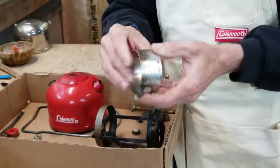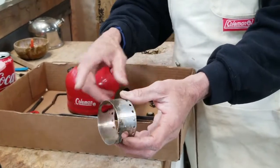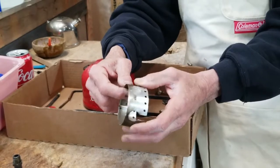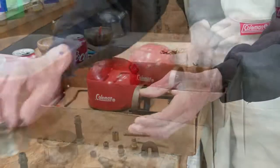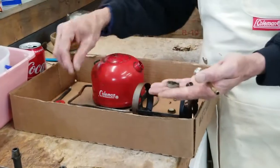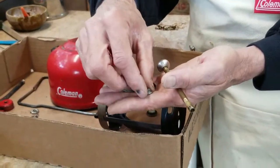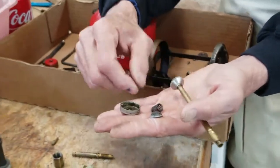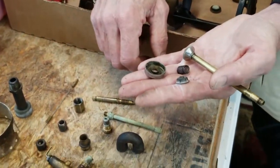For aluminum, I'm going to soak it in vinegar for a little while and then just take a rag and wipe all this stuff off — these usually come real clean. Small metal parts like those on my pump, or the pal nut for the frame — parts like that I'm just going to spray with carburetor cleaner and hit them with a wire brush.